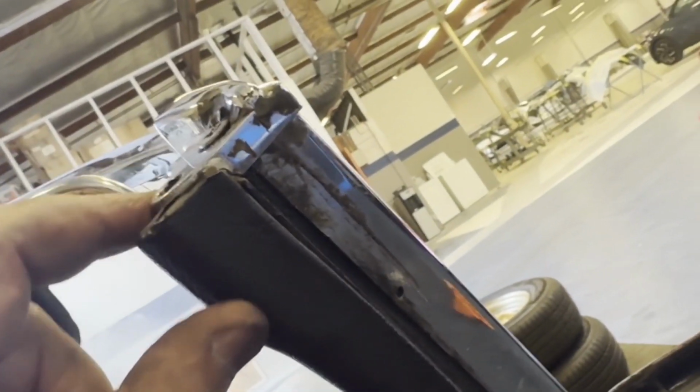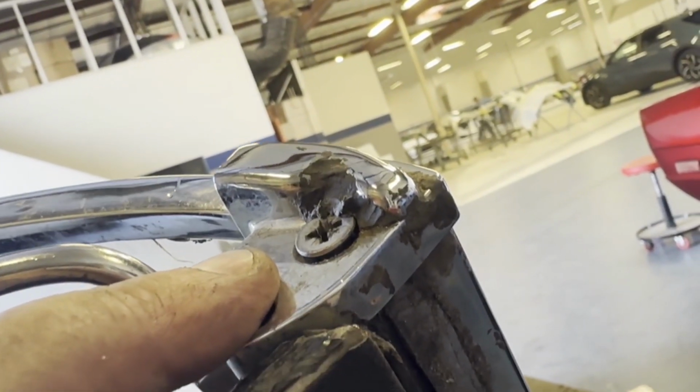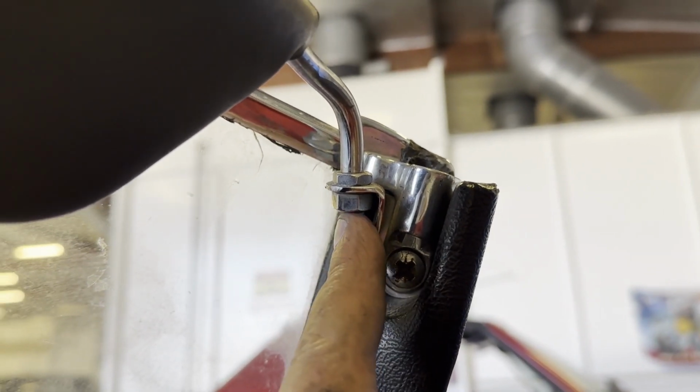Let's look at the chrome on the top of the windscreen. It's a large chrome top, and it looks like it's going to be screws holding this on the side. So where the stripping will come down here, and that's here as well, cut out the door. And these screws are missing, so I'm hoping just to take out this top screw here. Just look at this chrome strip, taking that screw out, but there's actually one here as well. And the sun visors come into here, this bolt at the bottom. That's it, one piece that comes across with this top.